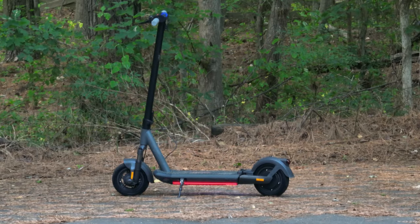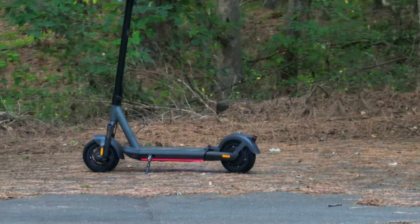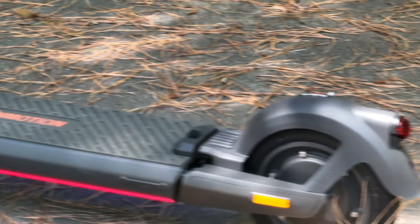The LED lights on the bottom and the turn signals are orientation-based — they detect which way the scooter is tilting. If it tilts to one side the blinker for that side turns on, and turning the wheel also triggers the blinker. The issue is that the threshold for how much tilt triggers the blinker seems off — even a slight tilt can turn it on unexpectedly.